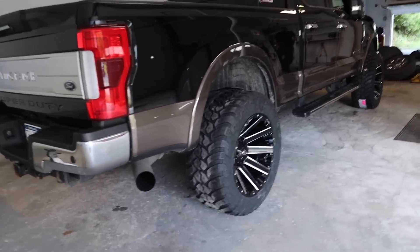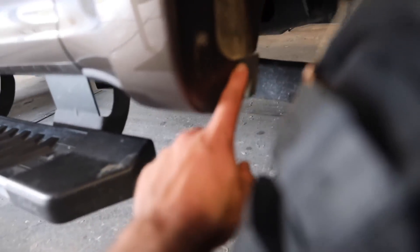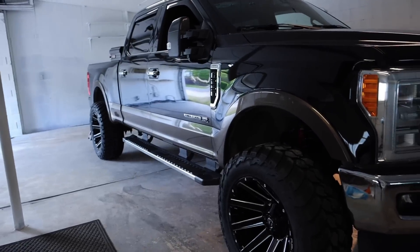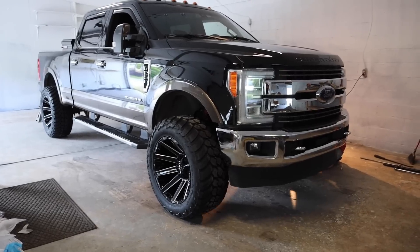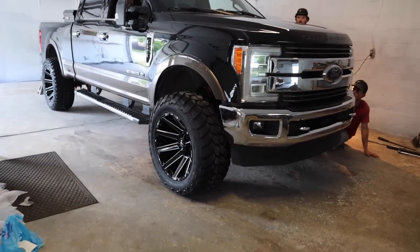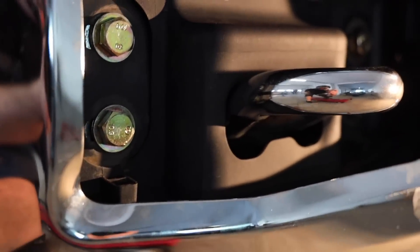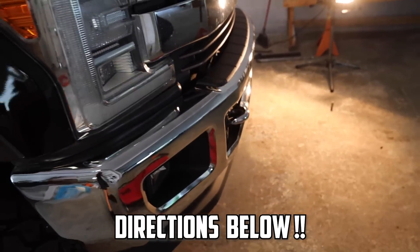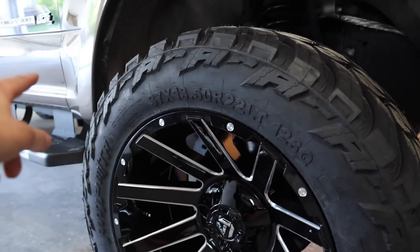It's probably not going to clear. We're going to have to do a bumper spacer and possibly trim back here because he has the fender flare on for the two-tone King Ranch, so we'll probably have to trim it just a little bit. It looks really good though — can't wait to get it outside for a proper shot. The bumper spacer went on in record time. It's just four one-inch collars that go behind the four bolts on each side with new hardware, spacing the bumper out from the truck.